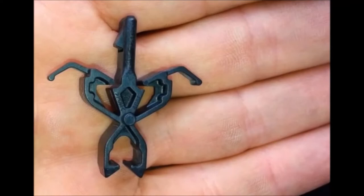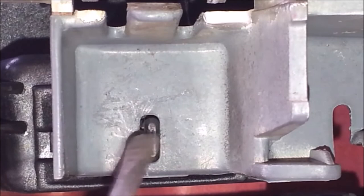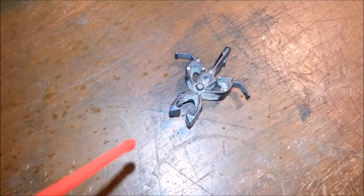If you can't get the jaws to release, you can remove the grill filler and push the tab to release the front of the clip instead. Spray the back of the large clips with silicone spray to allow the jaws to engage and release easier. Use your hand behind the headlight assembly to provide back pressure.